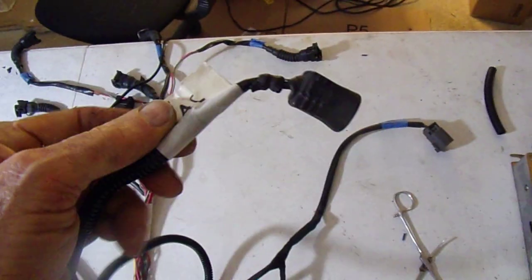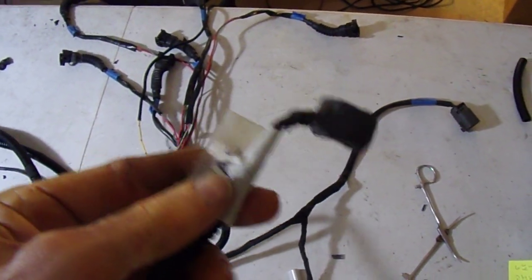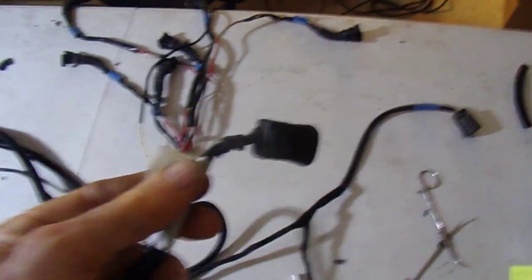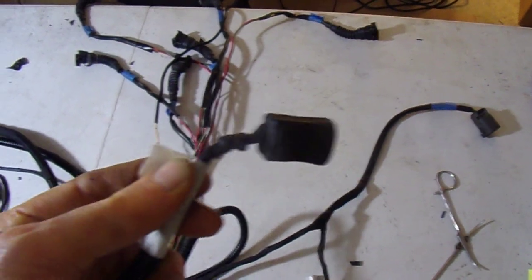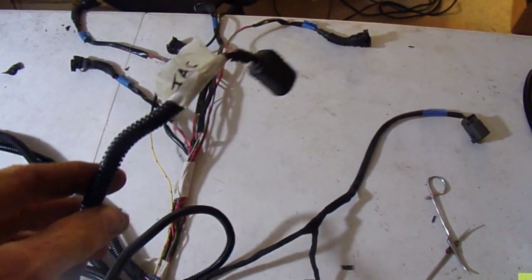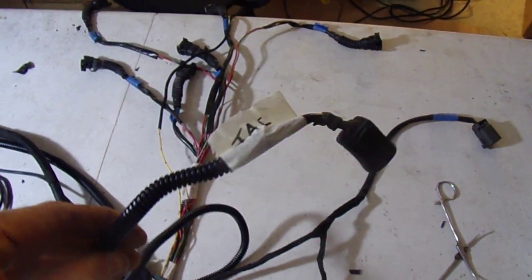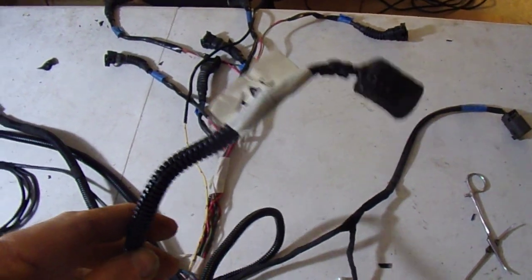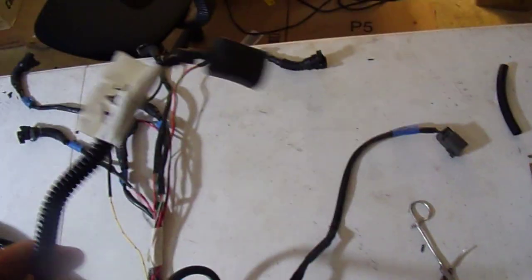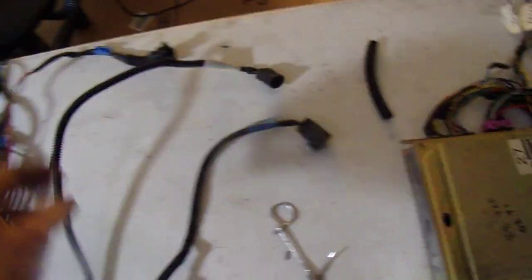This is the IAC. So this is the one that I'm going to work on. I'm going to probably have to use a MOSFET or some other kind of switching device that will take this and switch it to drive the IAC that I stole off the Fords. You know, those Fords have those IACs, but I think they draw too much current. I wouldn't want to overdrive it. So I'm thinking maybe even an ignition module might work to drive that thing. We're going to play around with that a little bit. I'm going to leave it out there. Don't have to use it, but if I can make it use it, might as well put it in circuit.